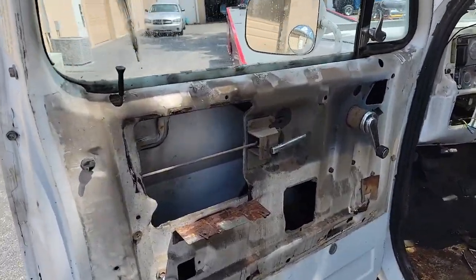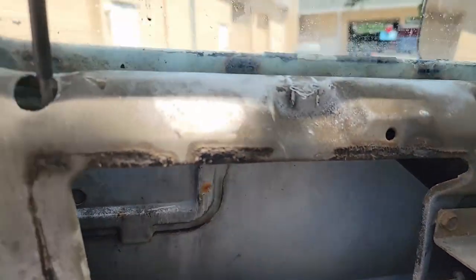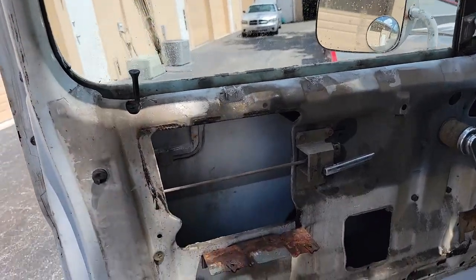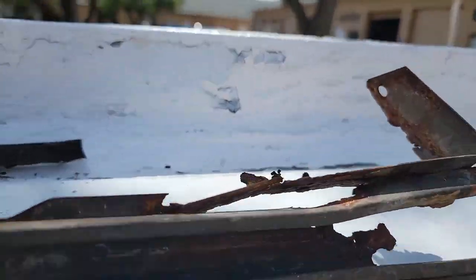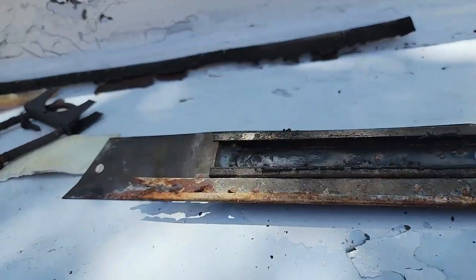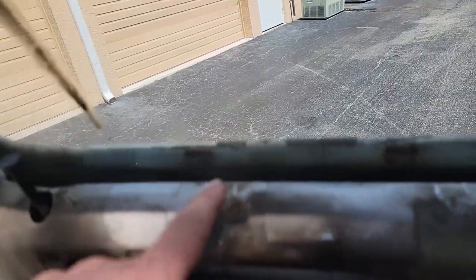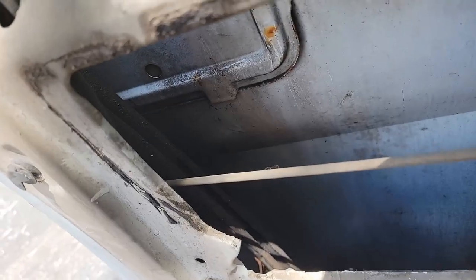Door panels are off. This window is the reason we took the door panel off in the first place — you had to move the window up and down by hand to let the track catch up. I thought it was off the rail, but it's not. There is no rail on that glass — that rail is a rusted beat-up pile in there. We need to order a new one. This channel here and the other side are just busting out — it's supposed to be rubber that hardened up.